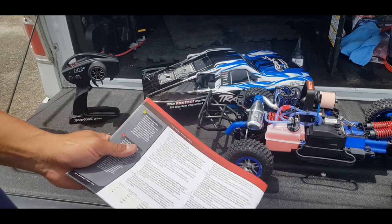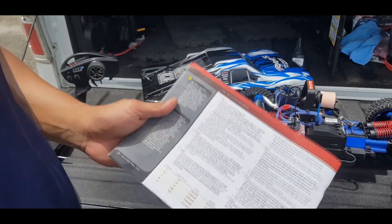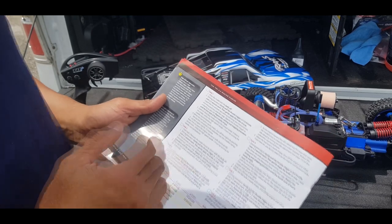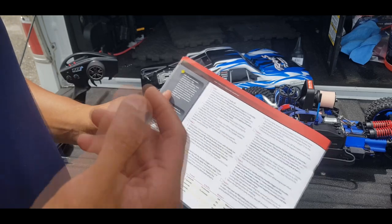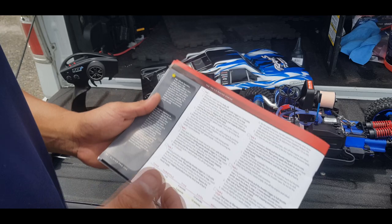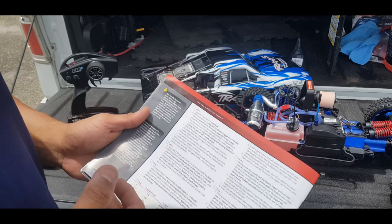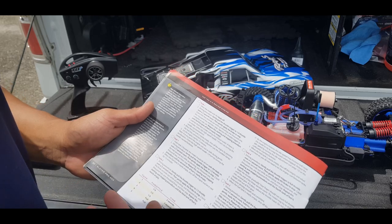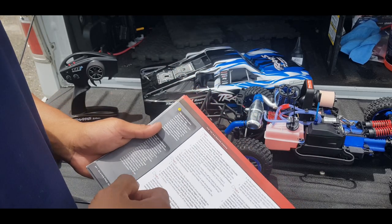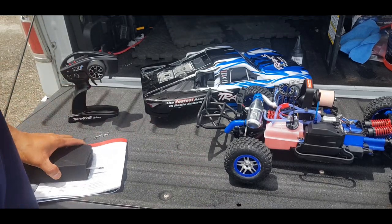All right guys, so for tank number two, we're gonna be driving with the body on at this point. From here we're gonna gently pull the trigger to half throttle. Tank one we did quarter, tank two we're gonna go half throttle, and we're still gonna go with a 2 second count, and we're gonna repeat this throughout the whole tank of fuel, just like tank number one. Before the fuel tank becomes empty, we're gonna pinch it off, and have the engine cool down for 15 minutes before we go to tank number three.